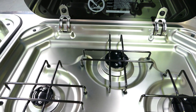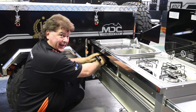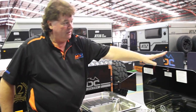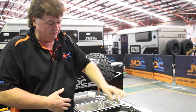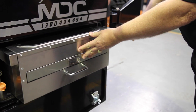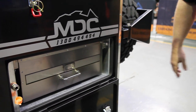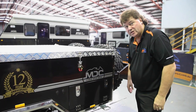So we're ready to pack our kitchen up. Unhook your gas line, unhook the water, and push all the lines back in under the sink. Take our drain line off — I'd normally store that under the sink now I've started to use it. The door's locked up solid. Tap goes down. Close the glass top — but if you've been using the cooktop, make sure it's cooled down; we're not closing onto a hot surface. To get the kitchen back in, simply unlock the slide and slide all the way back in. When you get to the end, it's got to lock back into position — you'll hear it clunk. Just give it a tug to make sure the lock's engaged. Close our door, and make sure our DC outlets are covered as well — we don't want too much dust getting into them.